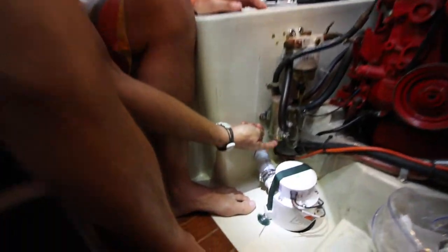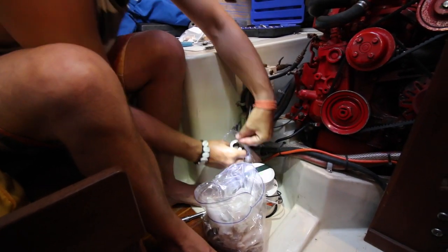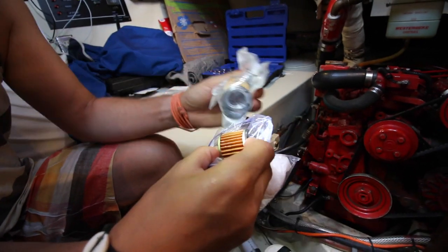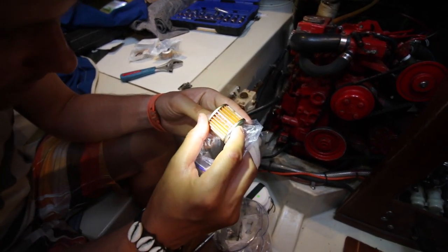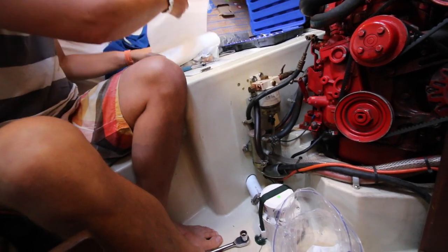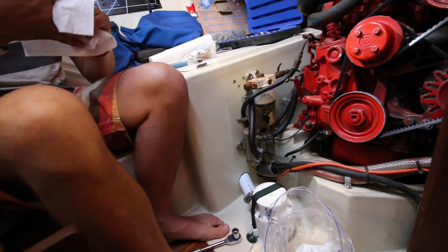The second filter is inside the fuel pump here, so this one is a bit tricky as well. That filter actually looks really clean — doesn't look like it's got hardly any dirt in it at all. You can see the brand new one here as a comparison, so we could just put this one back in — it doesn't look like it's got anything clogged in it at all. So that's the second one; we just put it back in because it looks great. We change these a little more often than we need to, but it's better a little too early than a little too late.